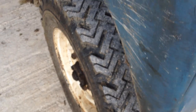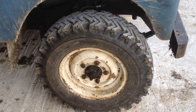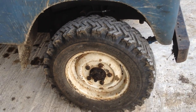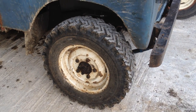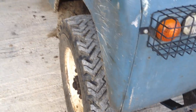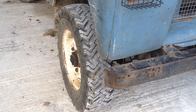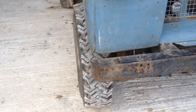Also what's changed - wheels and tyres. I think in the last video it had short wheelbase rims and Firestones on it. It's now got long wheelbase rims and Security Extra Grips. Obviously very loud on the road - not scary but interesting in the wet especially with the TDI, it's a bit slidey sometimes. But I love them. I wouldn't say they're better than the BFGs because you can struggle to do better than BFGs, but I had BFGs on it for a while and they made the steering quite heavy - they were a 265. Also had Goodrich all-terrains on it; they were a 235 on wolf rims, and they made the steering quite heavy as well. Quite like cross-plies - you can actually steer it and keep it in a straight line.